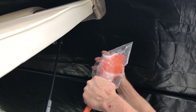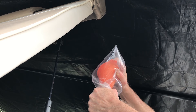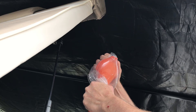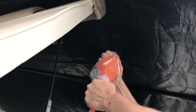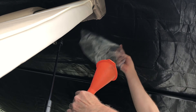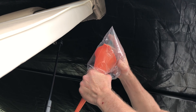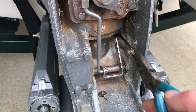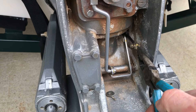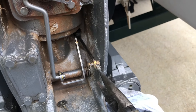Here's a better view of using the bag. I squeeze the bag to push the air out of it — that slowly pushes the fluid down. I'll take the bag off and start over a few times. You won't believe how much this cable freed up. This one was actually pretty stiff and now it's smooth as can be. You can see the oil starting to come out of the hole now. This one really freed up good.